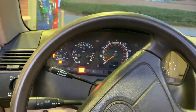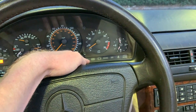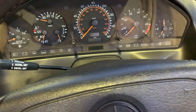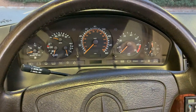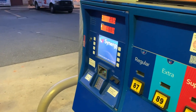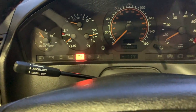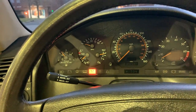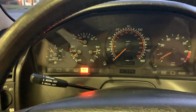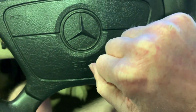I drove to the gas station to get some gas. Weirdly, when I first restarted the car after clearing the codes, the ASR and ABS came back on. But then I turned the car off immediately and turned it back on, and the codes were gone. Gas is expensive — I'm not filling up much more because I think I'm going to replace the fuel filter and I know I'll lose gas doing that. When I tried to put a new hose clamp on today, I lost a lot of fuel and got fuel all over my arm.